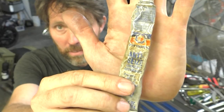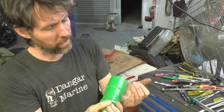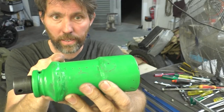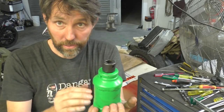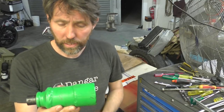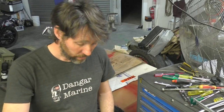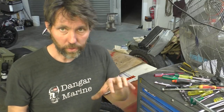This is just a little bit of aluminium anti-seize. I don't use it a lot, but it's nice to have an anti-seize that you know is compatible with aluminium, unlike a copper-based one. Another custom tool I made was quite a large socket — I can't remember what size — but essentially it was a large socket that I cut in half and then welded in a bit of steel tube. The reason is this has to go down over the top of a crankshaft to get the nut at the top of the crankshaft under the flywheel, so you need a quite long and large socket. Not something you could really buy — cheaper to get a generic socket, cut it and extend it. Because outboards always have lots of corrosion, an impact screwdriver is really handy — I'm going to do a video on corrosion soon and I'll go through how to use those.